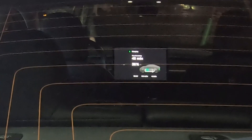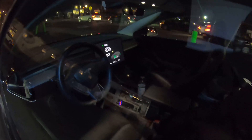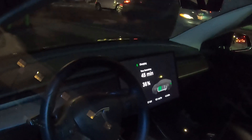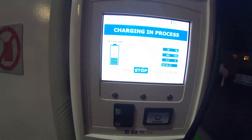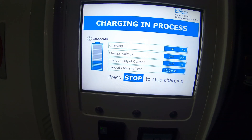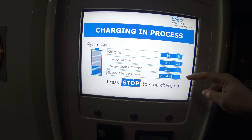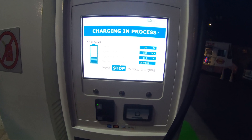And that's how you charge a Tesla Model 3 on the CHAdeMO. He's charging at 45 minutes remaining. He's got 35 kilowatts coming in at 141 miles an hour or so. He's added two kilowatt hours already, and it's only been a couple of minutes. So you can see this is the screen you get on a Model 3 when you're not in the car. So much more readable than on my Model X. The voltage and the charge rate on the CHAdeMO is a little different than on the Tesla station — it's actually going to ramp up. So as the car gets more full, the voltage will go up. The average is right about 100. And it's actually converting everything inside that CHAdeMO adapter. It's got a 50 kilowatt limit.